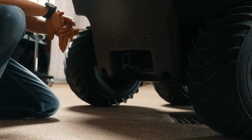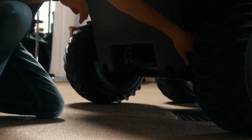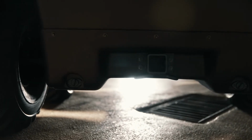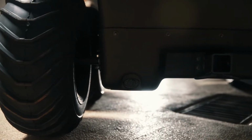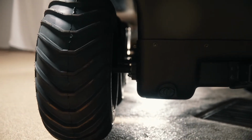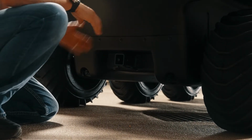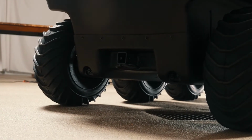One other thing I need to point out on the Frontier 650 is that the front and rear, or I should say corner axles, do not have the bearing extension housings that some of the other models have. This only comes into play if you were that guy that wanted to plow snow. You do need the bearing extension housings, and you cannot put a snowplow on the Frontier 650. Short of the lower body, I think that pretty much covers everything we've got there.